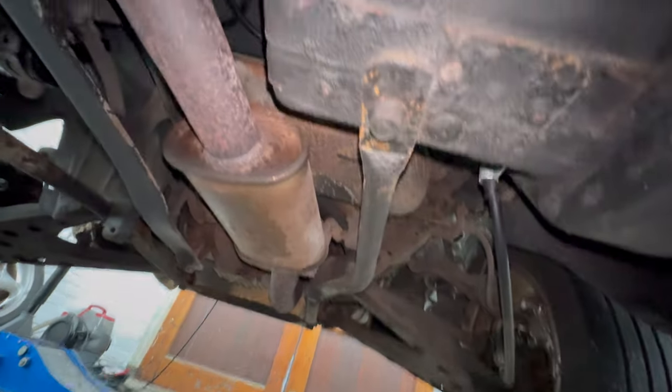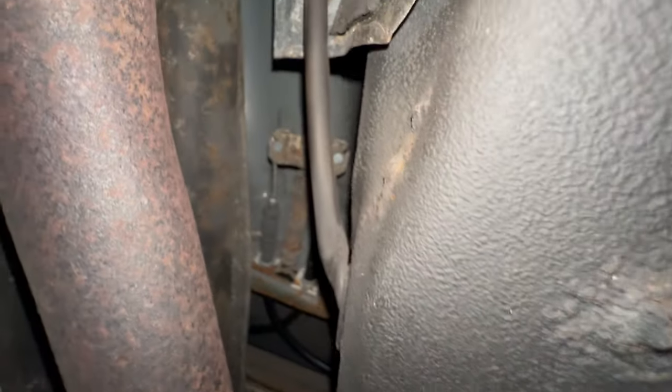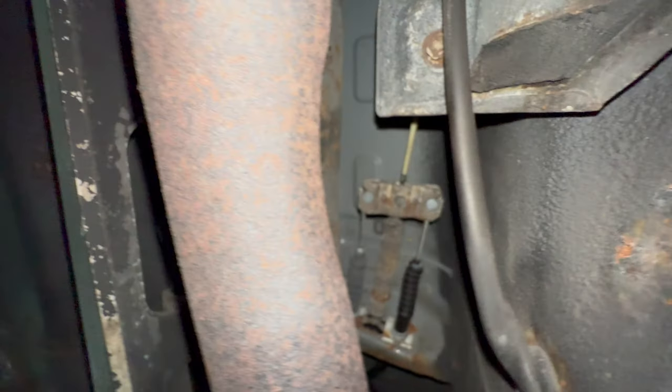Now, let's get that parking brake issue fixed. The first thing to check is if the handbrake cable balancer works properly. Somewhere in the middle of the underside of the car, next to the drive shaft, is this nifty contraption. As you can see, there's one cable that comes from the parking brake lever in the interior, which splits into two cables that go to the rear wheels.